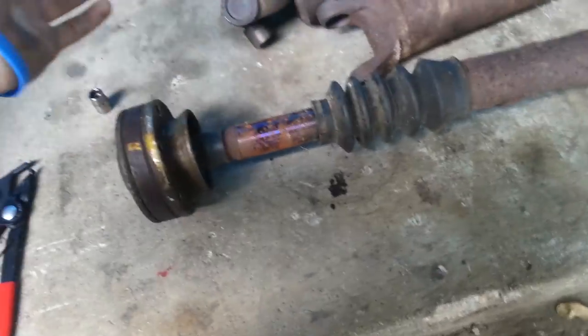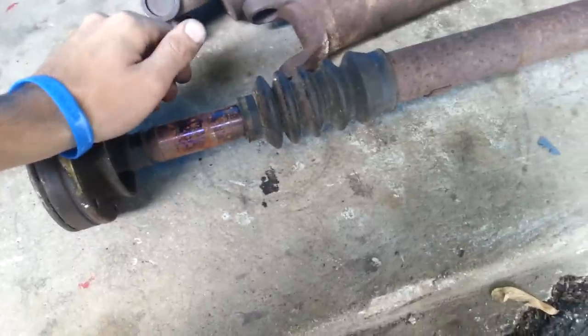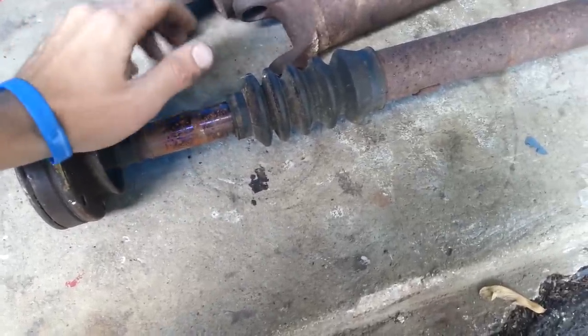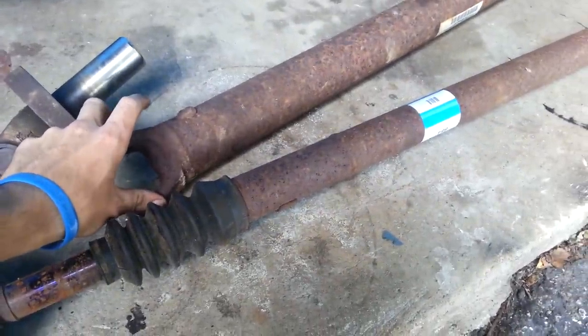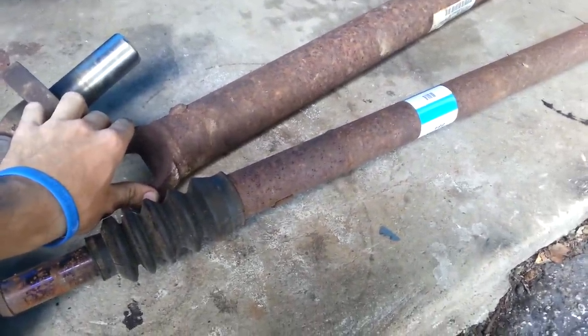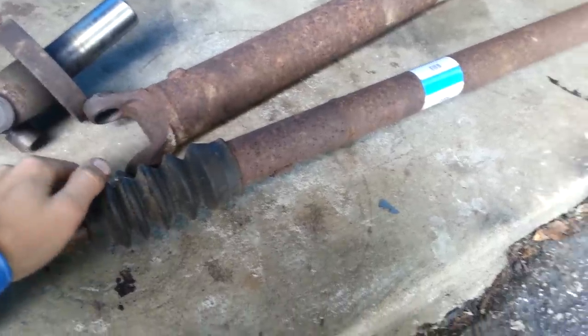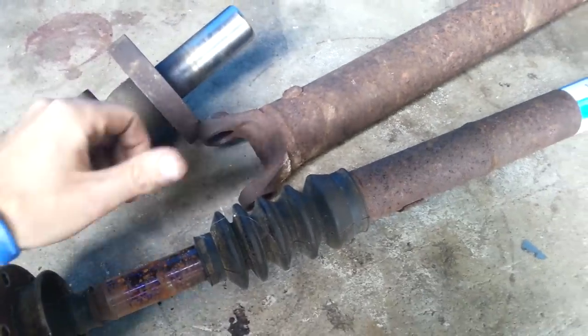You cannot reuse the front drive shaft. This is the front drive shaft from the donor Jeep — it is the Rzeppa shaft. Those are terrible, don't use those. The reason you cannot use this one is because it's too long, it won't fit. And the reason you can't use the shaft from the donor Jeep is because it's too short. So when you swap out those two parts, you make the perfect size drive shaft. You don't have to take your drive shaft to a shop to get it lengthened or shortened — you literally just swap out these slip yokes. I'll show that later in the video.